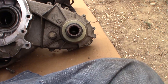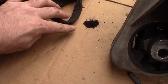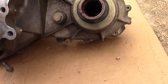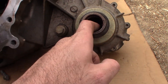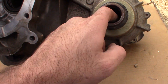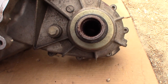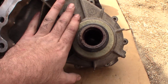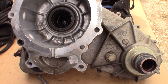The bottom right side and the top left side — that's where you've got to pry against to get it out. Eventually it comes out. Of course we drained the oil before we removed it. All this stuff just came out of this hole as I was flipping it upside down. I'm not quite sure yet, but I'm thinking maybe this is where some of the damage is. What we're going to do is take this inside, crack it open, and hopefully see that we've got a damaged chain.